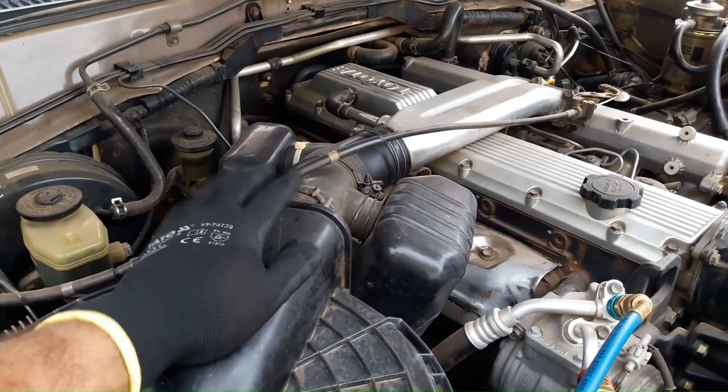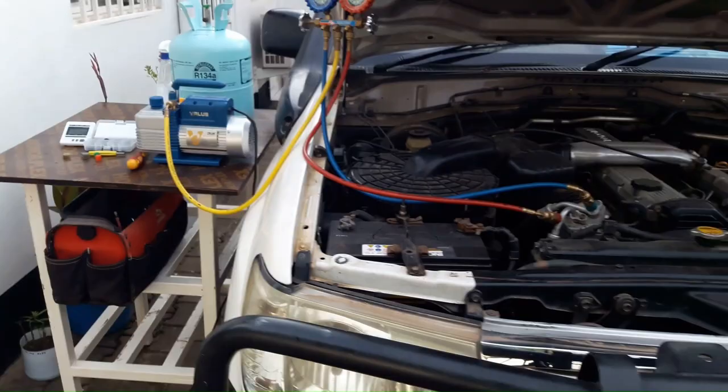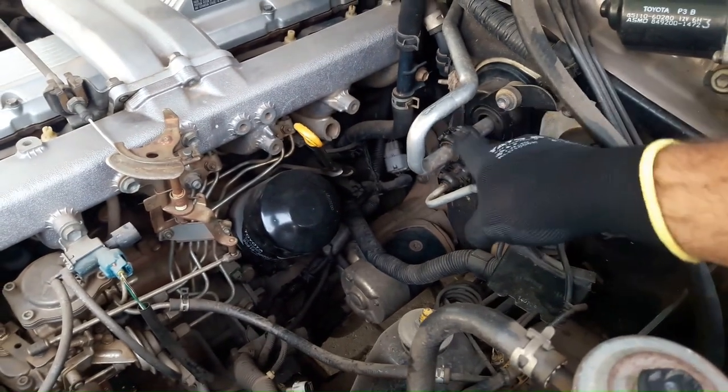You are gonna recharge the AC system after replacing a part in your car AC, or if it is not cooling and you find it is leaking somewhere. Before any repair or fitting a new part, first vacuum the system well, make sure it is not leaking anymore, and then recharge.